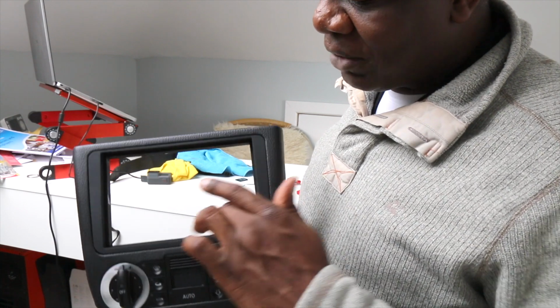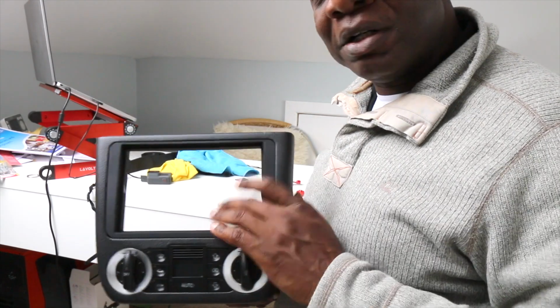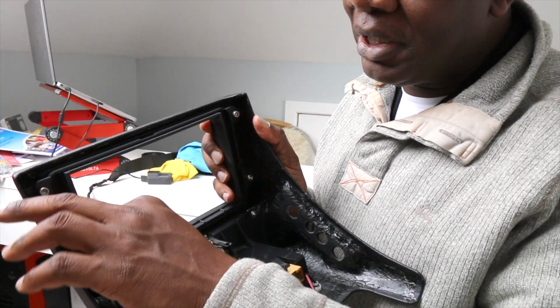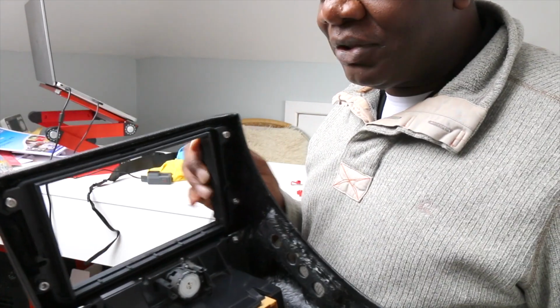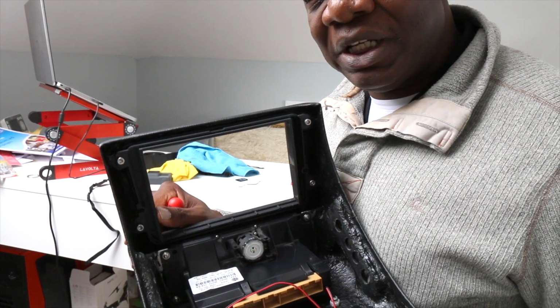get from the Volkswagen range. So basically the fascia for the Volkswagen, you need to get that for part of this kit, and then that bolts in with these 4 bolts from behind, and like that, and that makes it secure, which then means you can put your universal double DIN unit in, which we've got in the car.